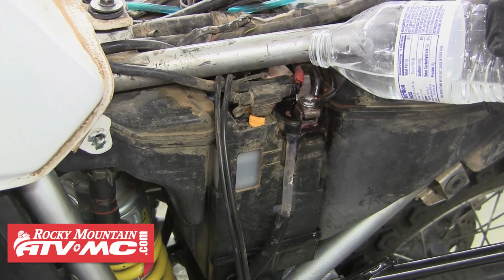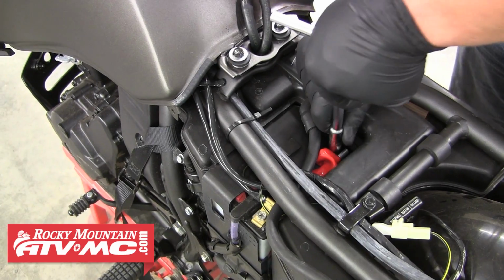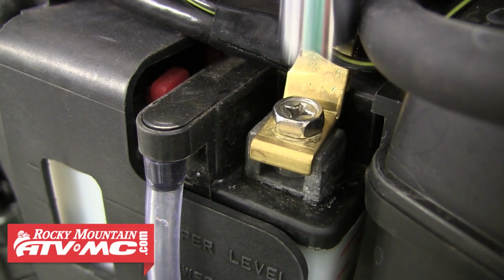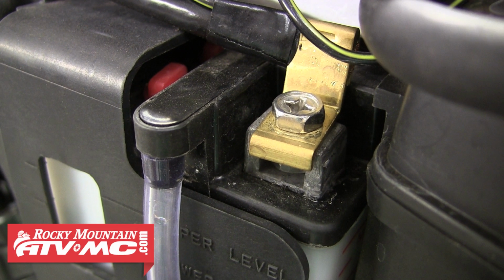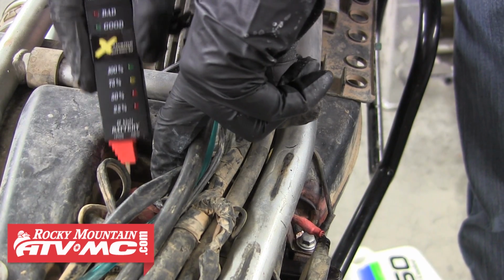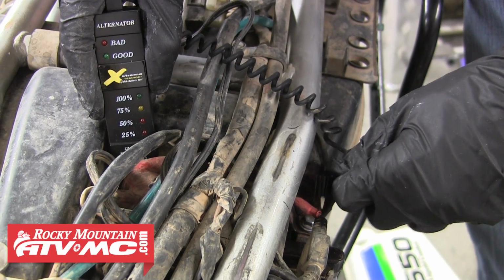It's also important to keep all your connections tight. Loose connections can also lead to unwanted discharge of the battery, so again, making sure everything is tight and clean, and then coating your connections with grease is going to help prevent corrosion and discharge, and it's also going to extend your battery's life. So now just to quickly review on maintaining your battery and keeping it fully charged.